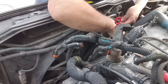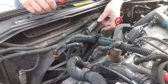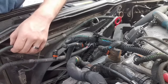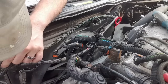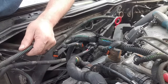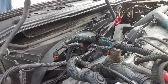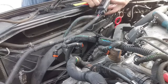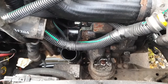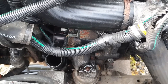Got the air conditioning lines down there. There's a small bit of wire and harness here we need to release. The harness here is part of the engine loom — this piece here, I assume it's something to do with the mass airflow or something like that. There's another cable tie — yeah, that's some other connector, maybe a coolant temp sensor. Professionally disconnect that. There's some other sensor here — professionally disconnect that too. Near it now. There's these engine mountings to get, and then we should be good to put this car back down and lift the engine out.